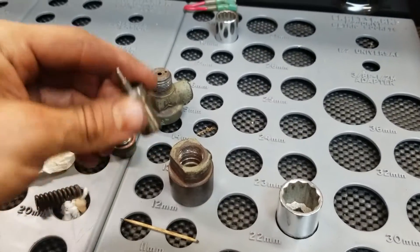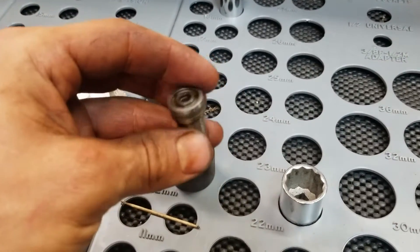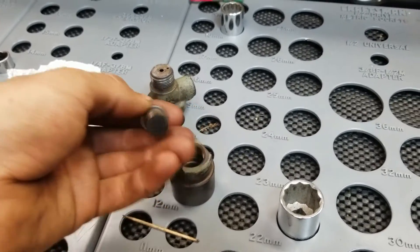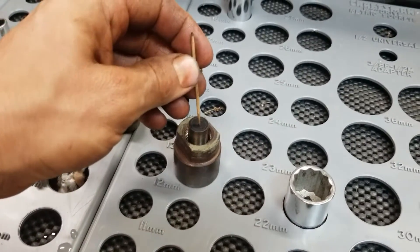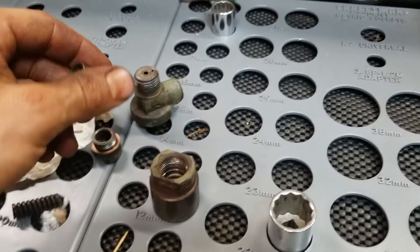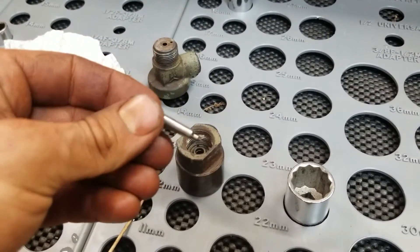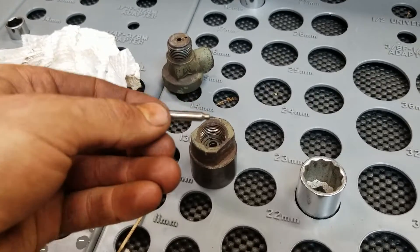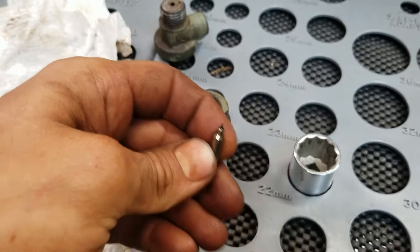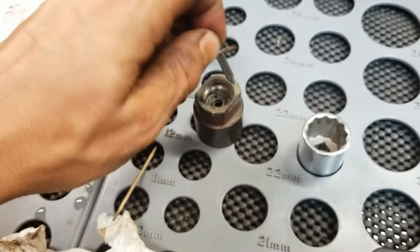The way this thing works is you have the little nozzle here. I'm working in the cleanest part of the garage because I don't want dirt getting down in these parts. The nozzle has that tiny, tiny little hole right there, and you just get in there with a toothpick — stick the tip of the toothpick in there and just move it back and forth. Then I put it in the ultrasonic cleaner and brake cleaner to get it cleaned up. After you clean this all up, the needle — which is super-duper precisely machined — slides up in here. You want to make sure that tip is absolutely perfectly clean with no carbon on it. It needs to be able to slide freely up and down in this nozzle, and it is. So, that's clean.